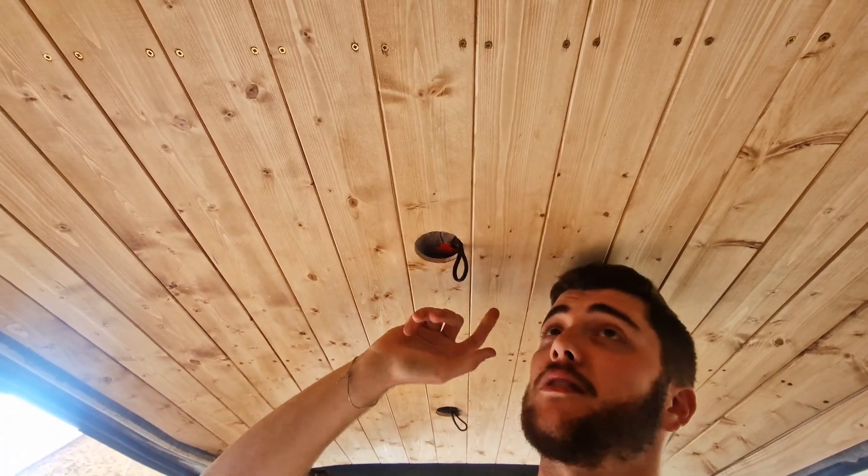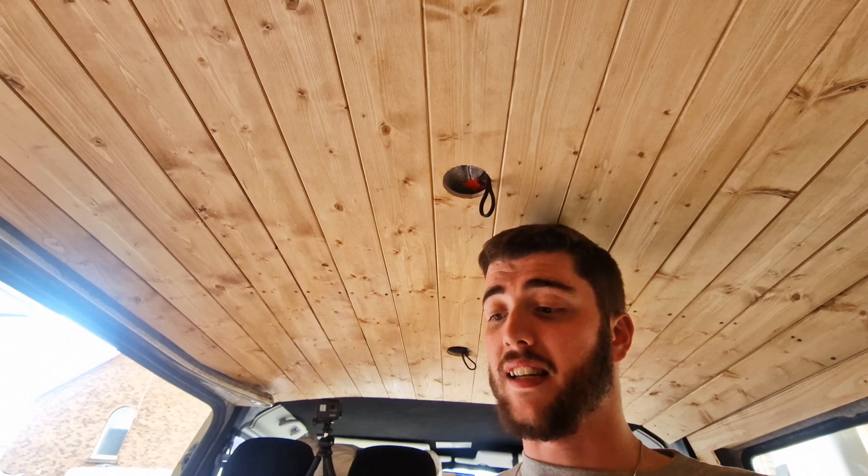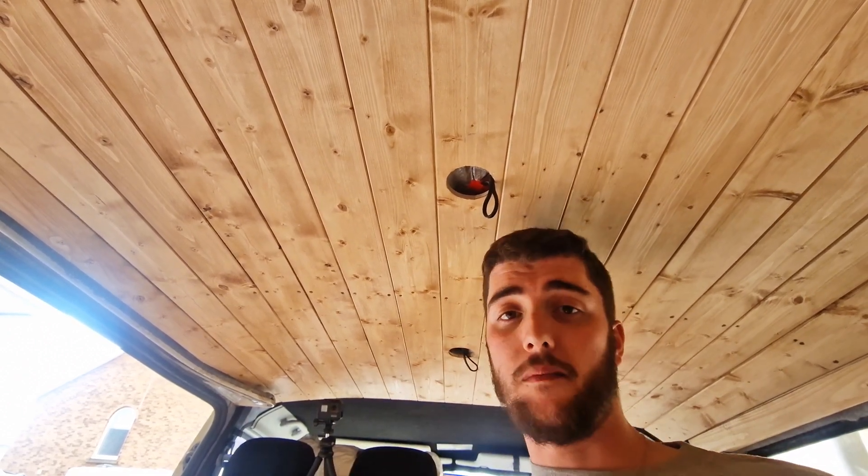Good afternoon everyone. Doing a bit more of the electrics today — we've just got the kitchen in. We're going to be moving on to getting these lights in. We did all the pre-wiring before the cladding went up: basically one 1.5mm split core cable going down the length of the ceiling for our three spotlights. We use these lights in our Fiat Ducato build — they're touch lights with a button in the middle, you can dim them and put a nightlight on, so it basically negates the need to run any extra cables down to a switch panel. All I'm going to be doing is cutting this cable, attaching three-way Wago connectors to the positive and negatives of each of the wires, and attaching the lights. The positive wire will link to the positive of the next circuit going to the next light and also connect to this positive — all the positives link to positives, all the negatives link to negatives. It's a super efficient way of doing it and it saves on cabling.